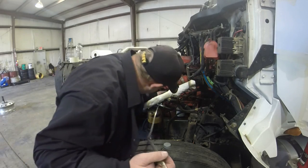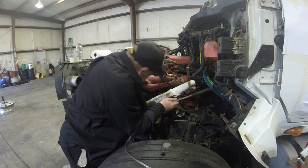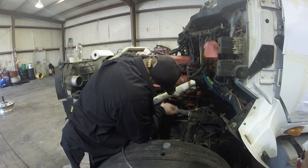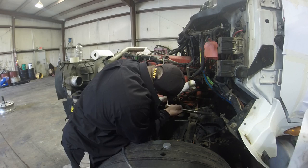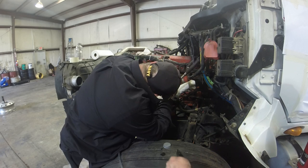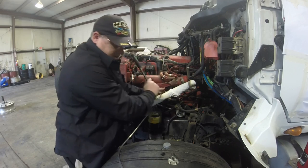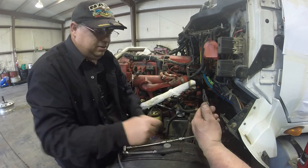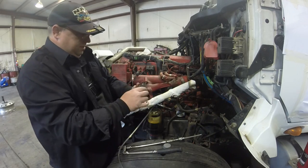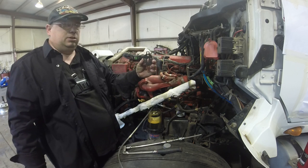That's fine. In the many videos I've seen, there's one question that I've always had that nobody seemed to answer. Maybe I won't be able to answer it either. Which way does that gasket go? I can tell you which way it goes. Dimples out or dimples in? Dimples towards the engine block, or towards the IFSM module.